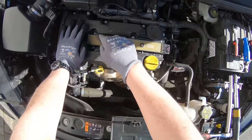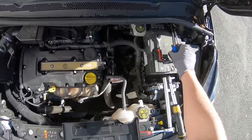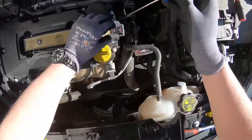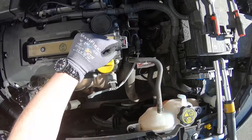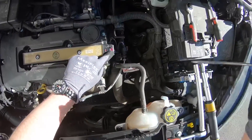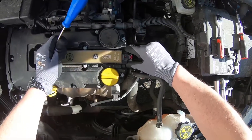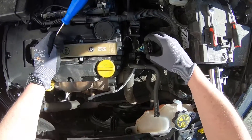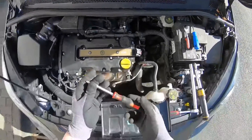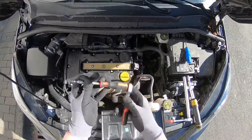For the safer way, we are going to unlock the connector of the ignition coil first. There is a red lock on top — this red lock we have to unlock first by using a flat screwdriver, and then we are going to unplug the power supply. Safety first: the ignition has to be off and the key must not be in the car.